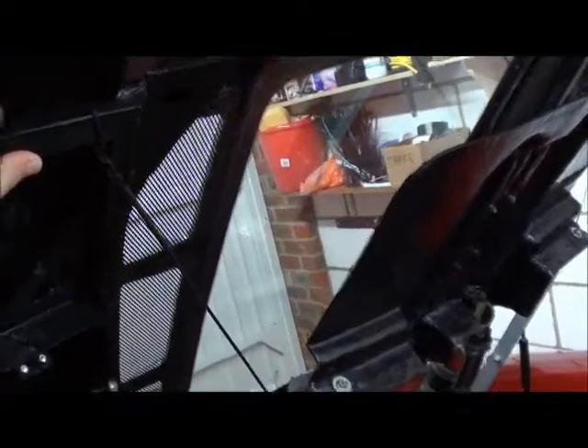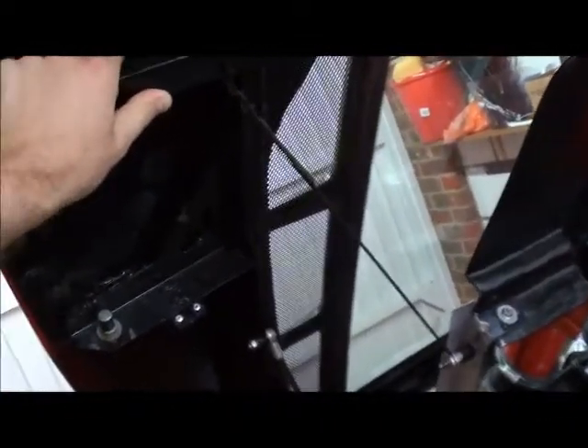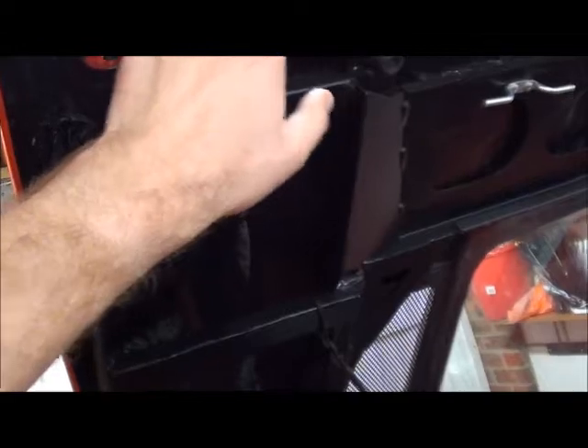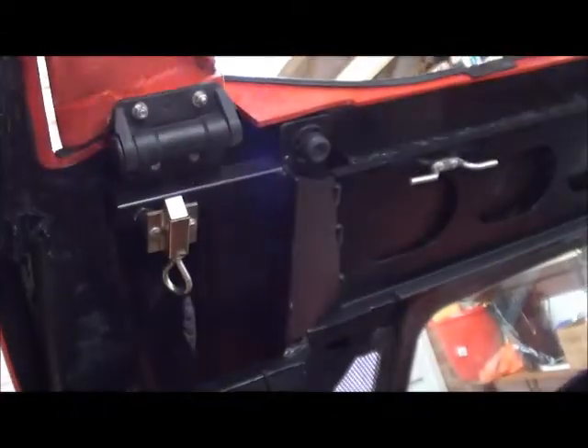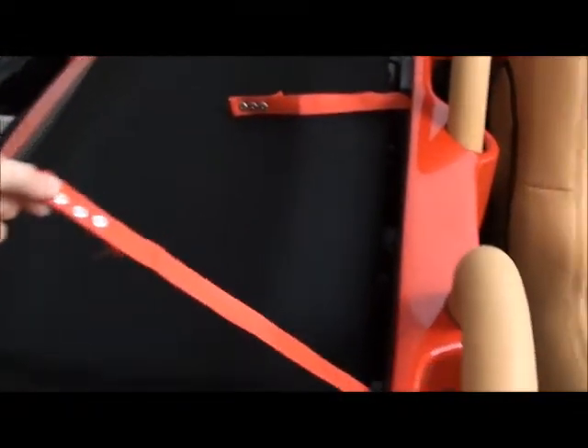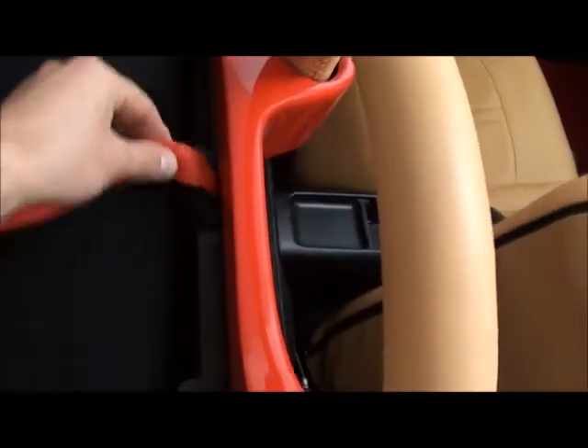I definitely recommend painting the underside of your rear deck black before you get it resprayed and before you fit it, because it's a lot easier than doing it upside down. Your pods will be a similar sort of thing and I've got these latches and strings that lock it into this area — they fold down and are good fun to fit up. These little things here are part of my rear deck safety straps — they pull down, are just riveted there, and the strap feeds down through the gap in the roll bar cover to keep the rear window down.